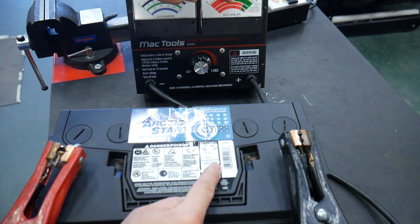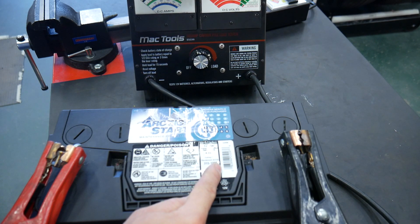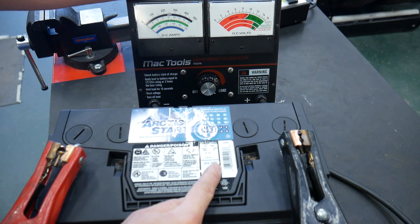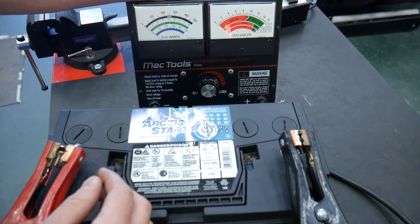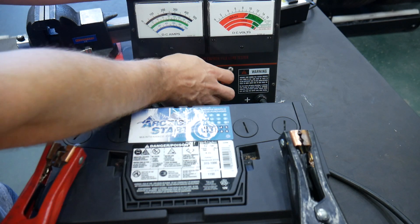This tool has a calibrated scale so we can know whether the result is acceptable. For us to use this 12-volt battery as a starting battery in our vehicles, we would need it to stay at least 9.6 volts. There is a temperature chart here as well, because the potential available in a battery goes down as the temperature of the battery goes down.